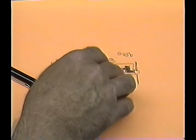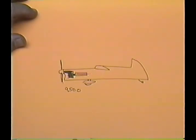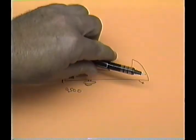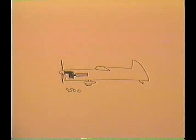It's better to do it in flight, but what's real nice about doing it that way is it gives you a real good starting point. You don't get the first flight, flip the plane over on its back and the motor shuts off, or it goes dead lean. So those are two little pieces of data that I feel it's worth passing on now to the people that are aggressively pursuing four strokes.